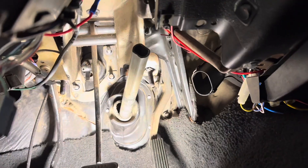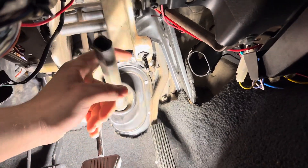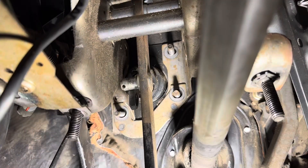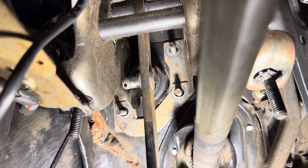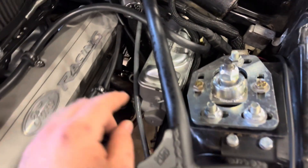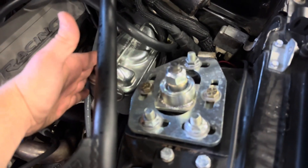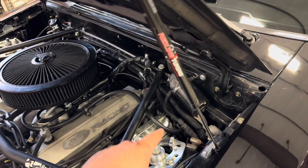I got the steering column out. When I pulled the steering shaft out it didn't pull the rag joint down there, so we're going to try to leave that in. I have all four bolts that hold the booster to the firewall out, the brake pedal undone, the clutch pedal undone, and the whole entire pedal assembly should come out. I have a feeling I'm going to have to take off my strut tower brace to slide the booster out. Let me disconnect the reservoir from the booster and take that out so I can slide the booster out.